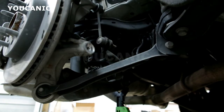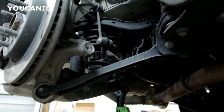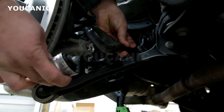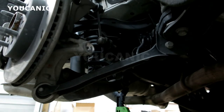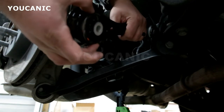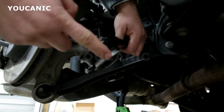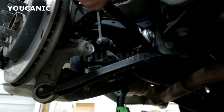The main issue is that if you hit any objects or have a hard impact on this wheel — left or right — what would happen is that the wheel just opens up. The reason is because this bushing right here basically just slides out of the link, and it's a bit of a poor design. So what GM did is they came up with a new design where the bushing on the outside has a larger diameter, so even if you hit something, it's not going to slide out because of this lip. On the old bushing you didn't have that lip. That's the difference.